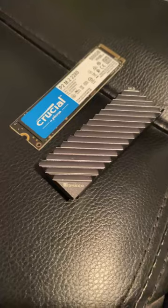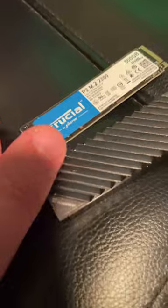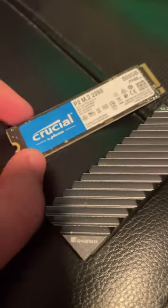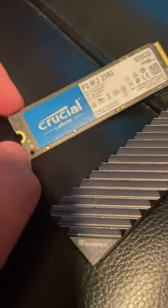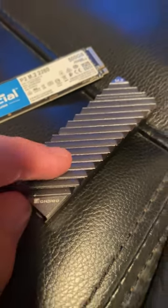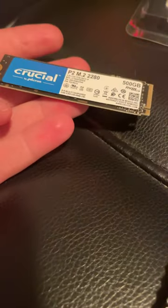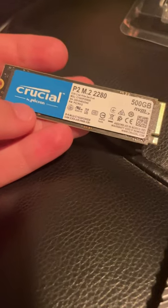But is something like this required? The answer is yes and no. It's important to define that there are third gen NVMe SSDs, which are a bit slower, and fourth gen NVMe SSDs. Third gen will very rarely get hot enough to require something like this, which is why there are a lot of motherboards where the NVMe slot doesn't have any sort of heatsink. But fourth gen NVMes tend to be a fair bit hotter, but faster.